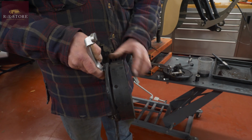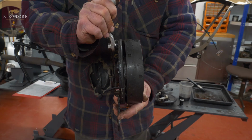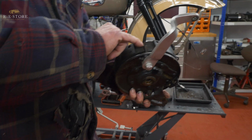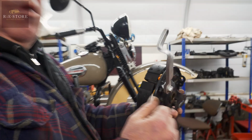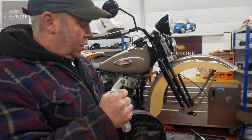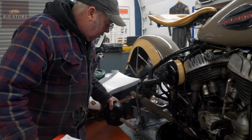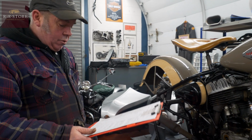And because when you operate those brakes, if you look at that shoe, when you do it, it'll do that. You can see where it's worn into the shoe there. Those shoes aren't level, they're ramping up that way. Because it's only pushed it, you're not getting full brake application as such. It's only working on half the brake shoe. Like shiny, worn, shiny, worn. So it's only working on that little bit. So replace that, possibly some new brake shoes, or give them a soak in petrol and a clean up. They should be alright. There's plenty of meat on them, they're just oil saturated.